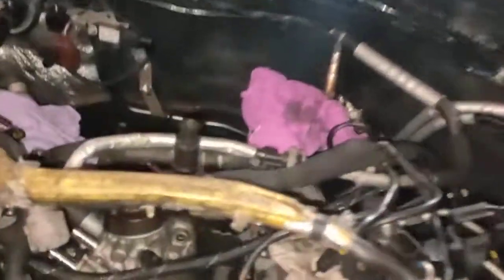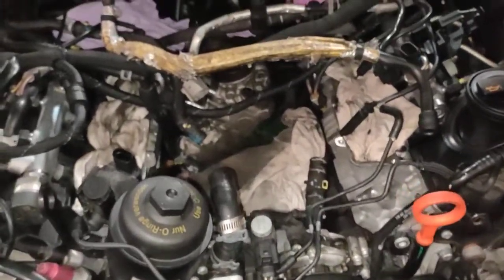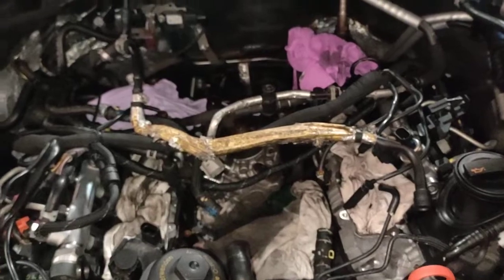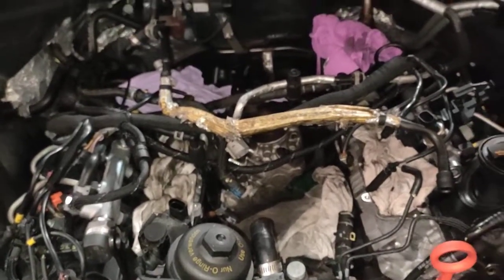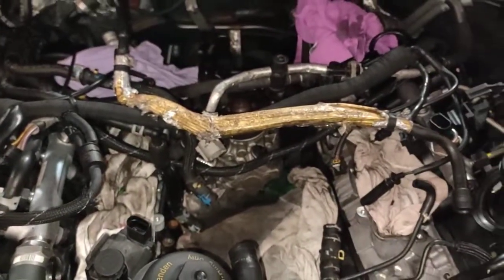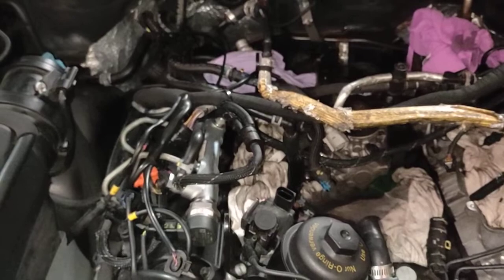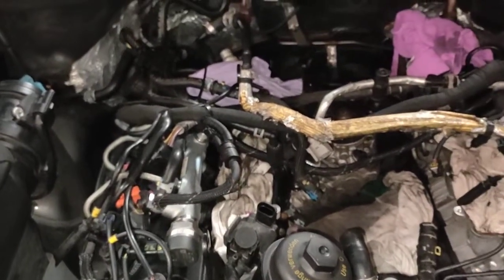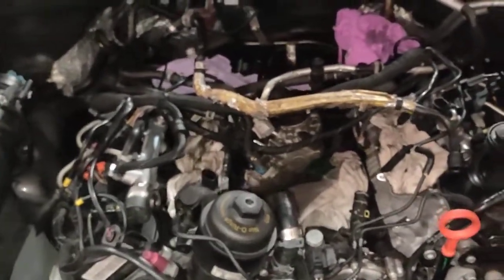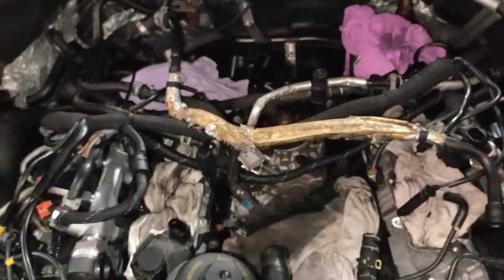I've done the pump of that car there. So this is the actual pump I got. I've got no high pressure fuel pump pressure — I've got no pressure. All I've got is 6 bar, which is the actual low pressure. When I crank the engine, I've got engine speed, I've got everything except the actual pressure increasing. If you've got an injector problem, the pressure will take a long time — probably extended time — to actually crank the engine, but the pressure will still build up. But if you've got no build up after cranking the engine for like 30 seconds, then you've got a high pressure fuel issue. The fault was locked — it was just low fuel pressure too low on this one.